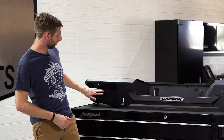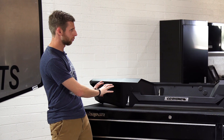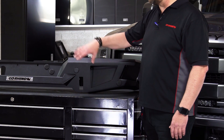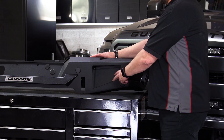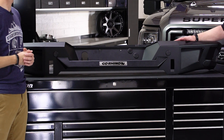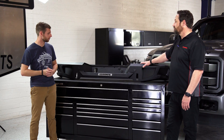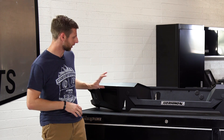One last thing to touch on: this bumper has delete plates on the sides where lights would mount. How does that system work? Some guys — like when they're hauling a boat and backing up at a landing — want rear backup lights. You can definitely put backup lights in the rear bumper. We ship it with just a blank plate since not everybody will add lights. But if a customer decides to go aftermarket and get a name brand like Rigid or another light brand, they can get the plates where they bolt right on and add lighting. Having those backup lights really floods the area and makes it more comfortable to back into dark spots.